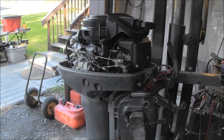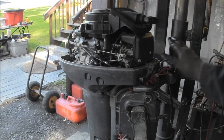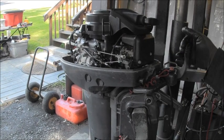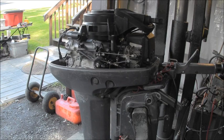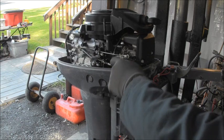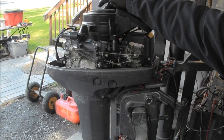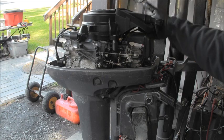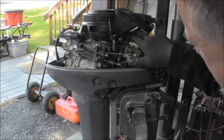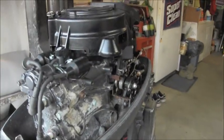There's the motor in question, and so it's in reverse now, and I can put it in neutral and then forward. It should throttle up, but if you look at the butterfly right here, it's hardly doing anything. What's going on is this cable that comes from the safety interlock on the recoil start comes down around over across the top of the air silencer down here, and it hooks to some linkages and so forth down in there. This is a really salty little motor.